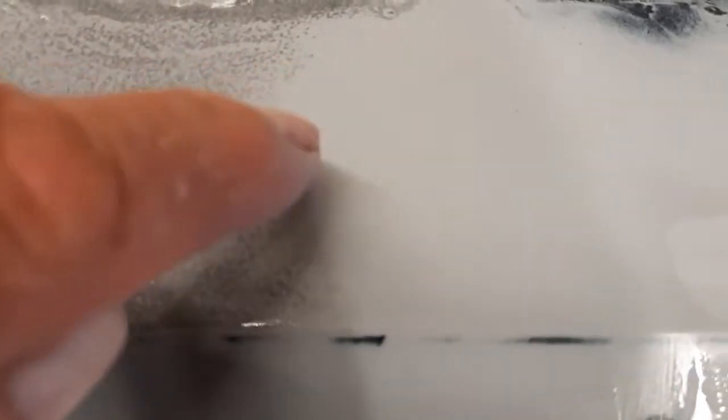If this was a tank, I'd have to fill in or recoat another 2 or 3 coats of this high build and sand all these little pits out, all these little pits that you see that are still black, which is the guide coat, meaning that it's really, really low.